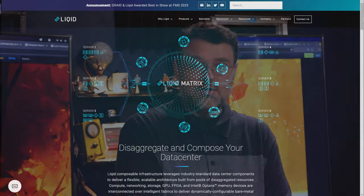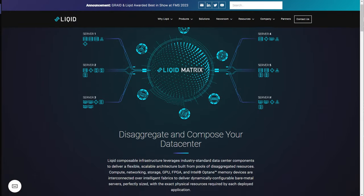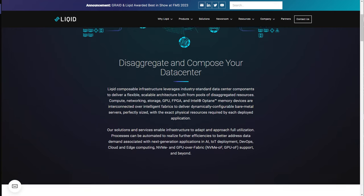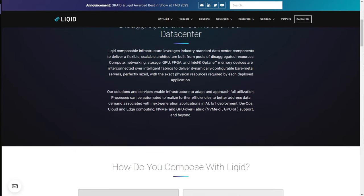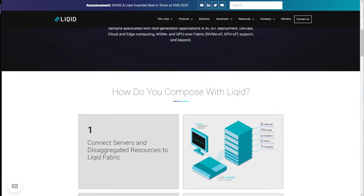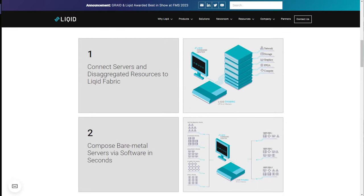If you need more PCIe connectivity, let's talk Liqid disaggregated storage. 32 gigabytes, 35 gigabytes per second isn't enough. Okay, you drop down to 20 NVMe instead of 24 usable, because remember the other two are just for boot drives. Those are only 2 lanes. Although you could use those. I mean, in a multi-tenant scenario, that's going to matter less. But, you know, again, I'm ceding ground where I may not even have to.